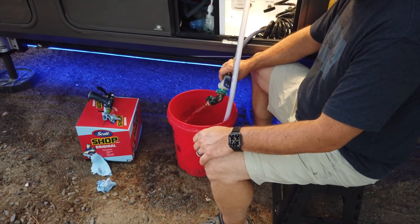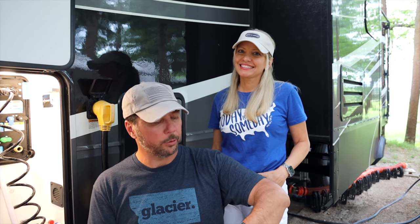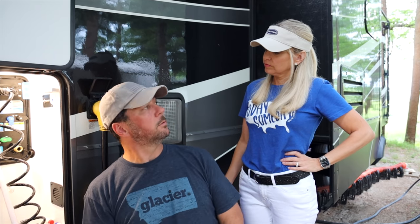The last step is to fill the bucket about half full to dilute whatever little bit of bleach is left, siphon that to the tank, then hook up water and fill the fresh tanks until they overflow. I'm switching this back to sanitize mode, which is siphon-to-tank mode. Our entire system is full of bleach water and it will sit overnight — about 12 hours, which is right in that 8-to-12-hour window. One thing I thought of: my plan to top off the freshwater tanks using the power fill will work for the tanks, but there will be a section of line between the fill station and the tanks that's just fresh water. So I'll power fill until it just starts to overflow, then put about another gallon of bleach water solution through so those lines also have bleach in them.